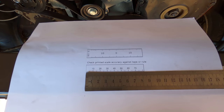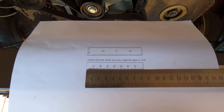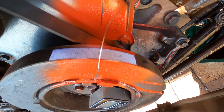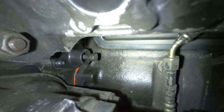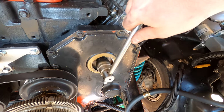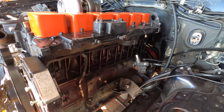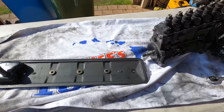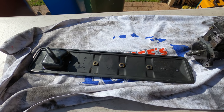This is printable timing tape — you have to check the printed scale and make sure you put the diameter of your harmonic balancer in correctly. I've set the engine to top dead center and I'm removing the P-pump. I have a set of 4K governor springs to put in. While I've got the pump out I'm also going to replace the tappet cover which turns out leaks.